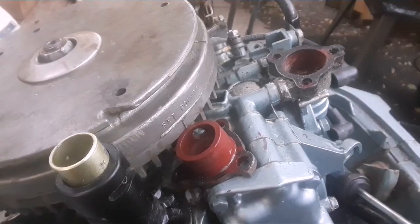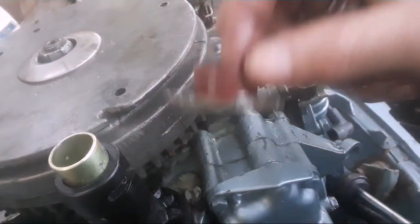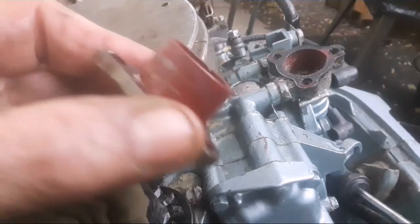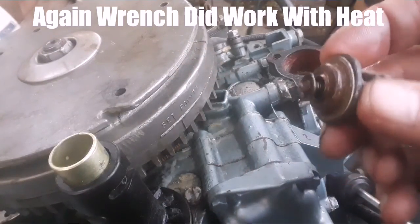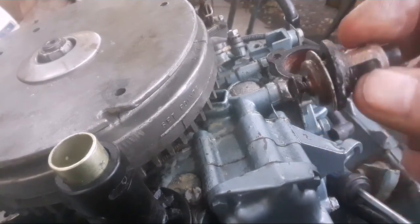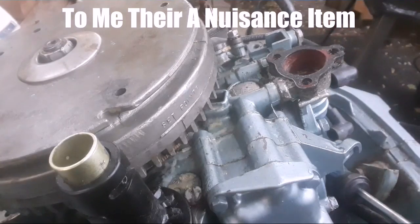The thermostat came out — even though I couldn't budge it with the wrench, prying it up worked. Very little corrosion, already hit it with WD-40. The thermostat was stuck open, and luckily it wasn't stuck closed — that creates a bigger problem. But after it cooled down it still stayed open the whole time, so it was shot. Now I'm just going to put the cover back on and try to start it.